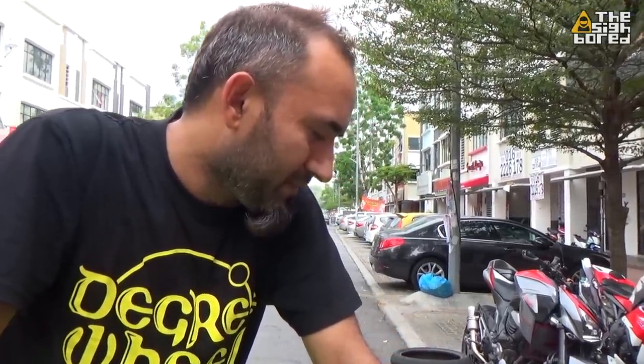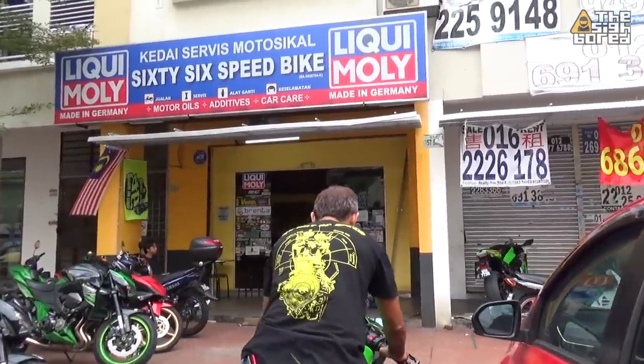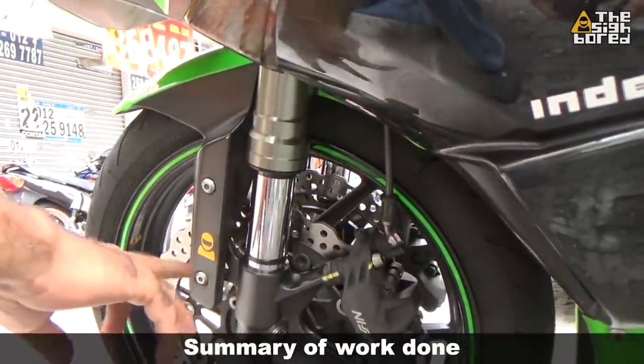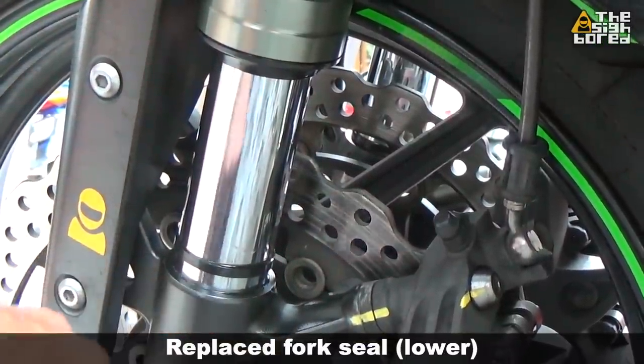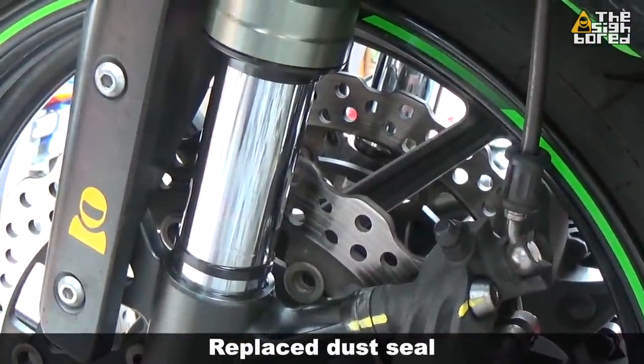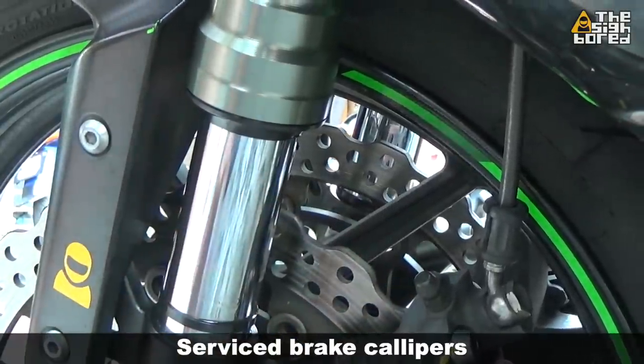It's easy. When you hit the brake or drop into a corner, if the fork is too soft, it starts to have what you call chattering. But it's not chattering at all — it's good. For 600cc, you have to do slides properly. It's not slamming down hard because last time we already set your sag — we didn't change your sag so the sag is still nice. I'd say this is with good braking feel — I've done hard braking behind the garage and it's still okay. It's nice. There's some oil I applied to the chrome but you have to monitor it. Monitor for one or two days — pour some water on it and check. If it's still dripping then there's something wrong. If not, it's okay.